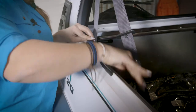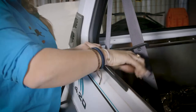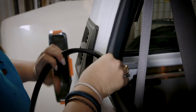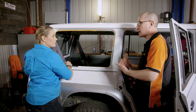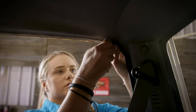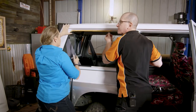This is the next bit you're going to be doing — a bit of pinch weld. That just needs to be stuck over the seam, making sure that you capture the roof lining and any trims. Starting in the middle at the bottom is preferable so that you can't get water running up in there or sitting in that gap. It's quite important when you get to this part and around the back to make sure you're capturing the trim and the roof lining.